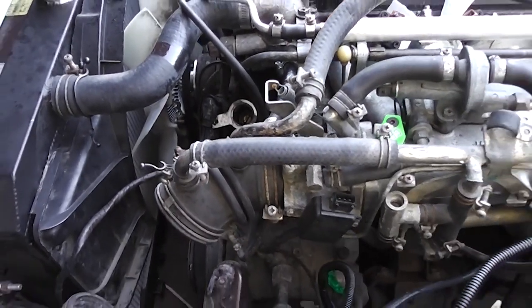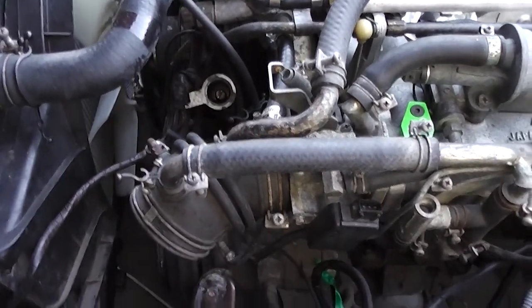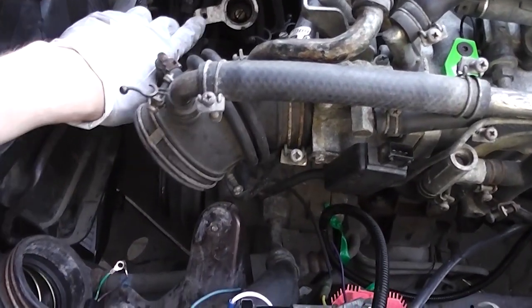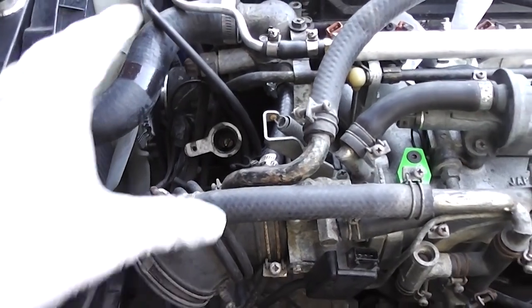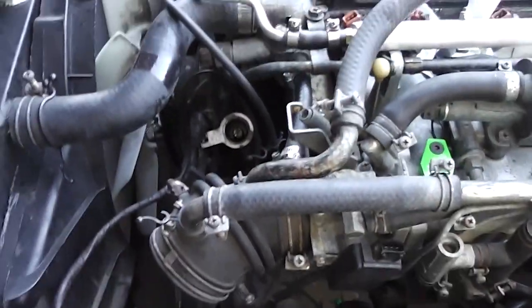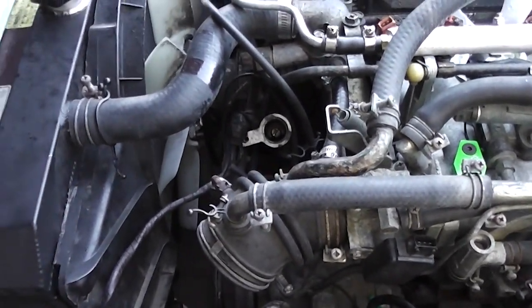In the meantime, I'm going to start swapping out the distributor shaft and oil pump. I have the stock distributor off already — it's literally just one screw for the timing set that holds the whole assembly in place. The whole unit comes right out after you disconnect the electrical connectors and the vacuum advance, and down below is the oil pump.